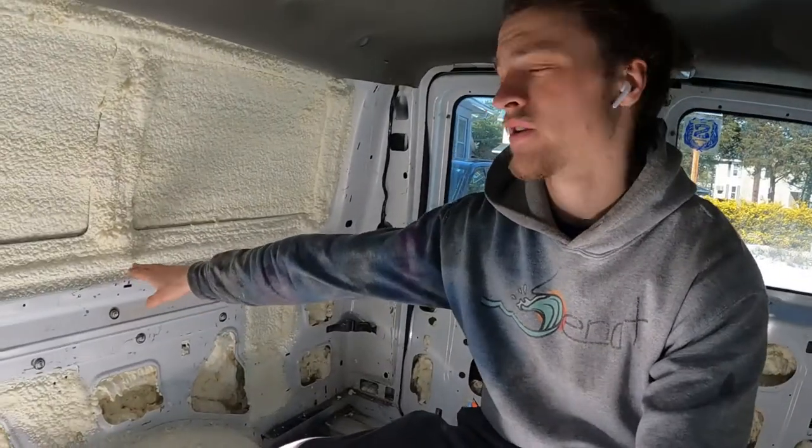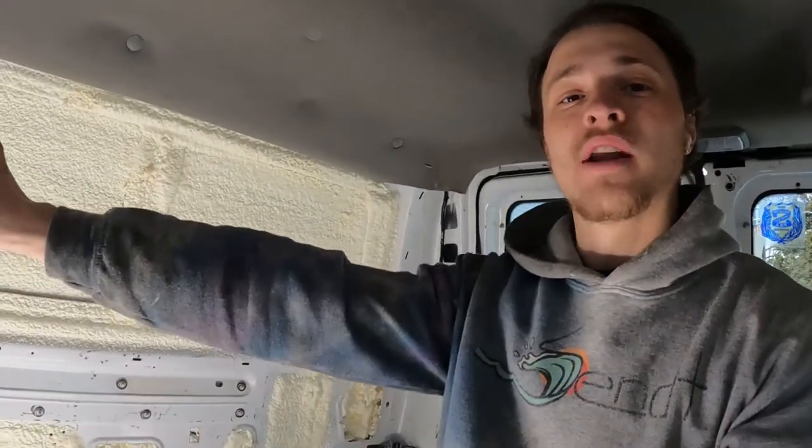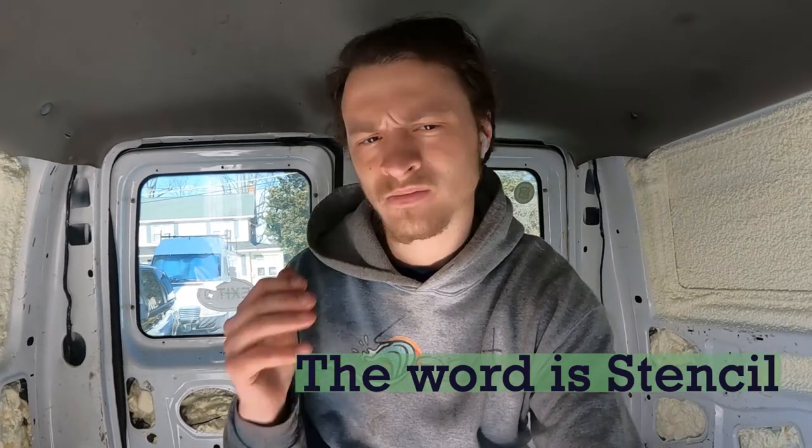With as small of a space that it is, we wanna be really smart on how we do this. So everything that's not showing, which in this van is pretty much just everything below the midline here, I'm gonna cover with an 1/8 inch laminate paneling. It's waterproof on one side, so that side will show in. And it's pretty flexible because these walls are very curvy and they got weird spots, even more so than a Sprinter. And then the top sections up here and up here will be cedar tongue and groove pieces. And then for these back panels, I'm gonna use the same panels over there as tracers. What's that word? Well, I'm gonna trace those panels onto laminate that looks like wood, probably, just so it looks a little nicer, and same with the sliding door. So we'll get to it.